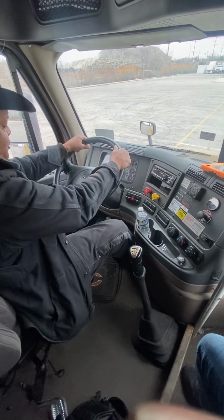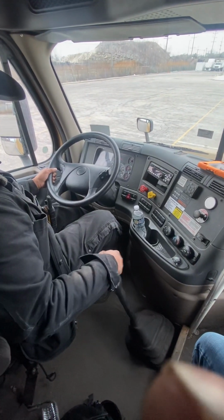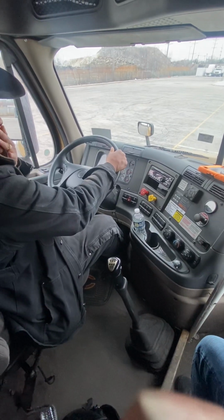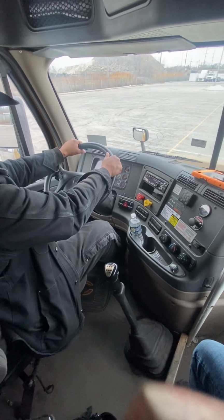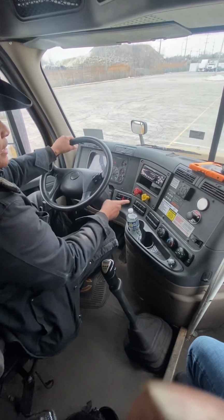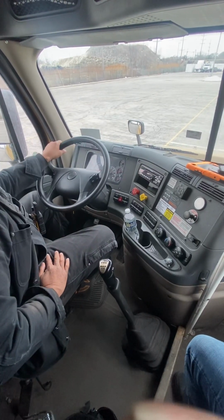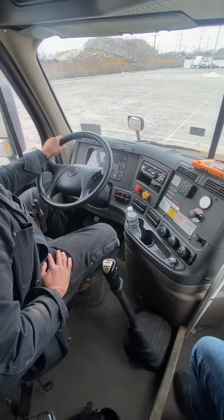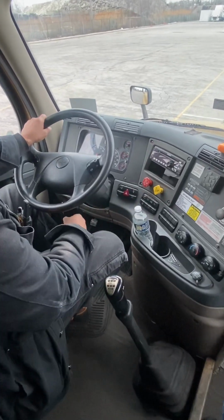So, applied pressure setup. We're going to clutch in the vehicle, first gear. This time we're going to cut the vehicle off. Turn it back on to auxiliary. We're going to take our foot off the clutch. Then finally, we're going to release tractor, trailer brakes. We're waiting for all the air to leave the system.